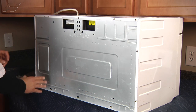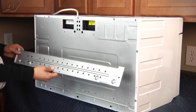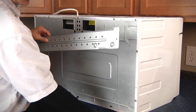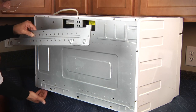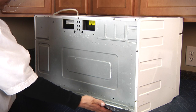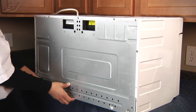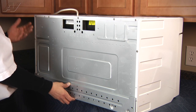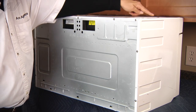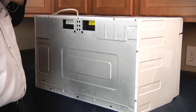You also have a mounting bracket that goes along the bottom. It has two hanging tabs, and if you look on the underside of the microwave you'll see two holes where these tabs hook in — that's what holds your microwave up. We're going to mount this part on the wall, and then the microwave will hang from here. There are also two holes at the top where the mounting lag screws go in to hold it tight to the cabinet.